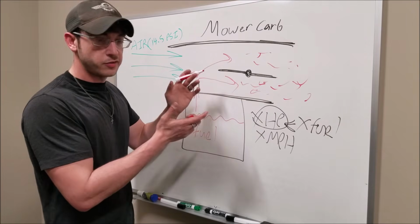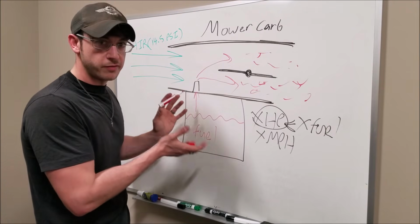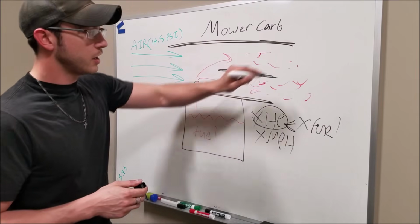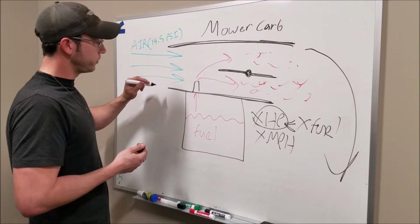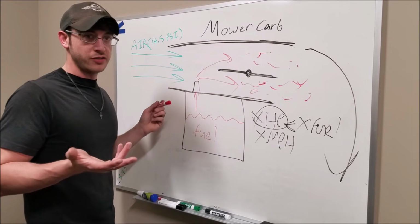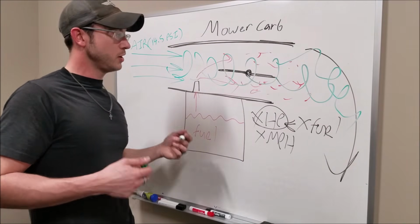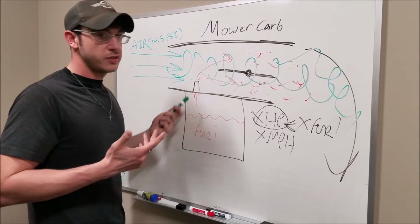But in this case, we're atomizing this fuel so well that we're getting the same power content out of a smaller amount of fuel. It's taking less fuel to get that same gas state volume that we need to make the horsepower. Now, to make this even better, and mildly unintentionally, I cut a hard 90 on that intake, and you can see on the air filter side there are two hard 90s going inside. What is this doing? This is an old trick, honestly. You see a lot of folks do this. It creates a lot of turbulence, especially this 90. Is it great for high flow, max performance stuff? No. But as far as atomizing the fuel content, it's going to work like none other.